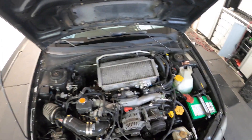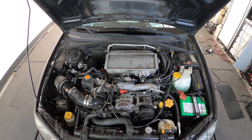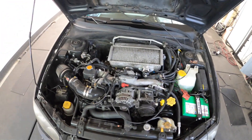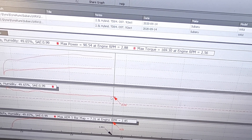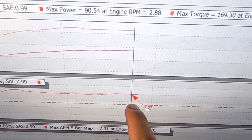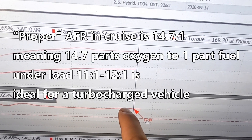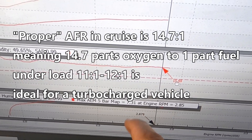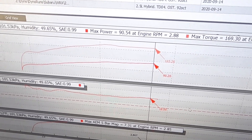So let's show you how I sorted this out. This engine had failed, customer brought it in, had us rebuild it — we built a brand new motor and put it in. I put it on the dyno and immediately ran into this issue. Here we are on the dyno screen — I only did a pull out to about 2800-2900 RPMs because our air fuel ratio right here was 15.9, you can see the AFR up in the 16s. This was on a base tune that should run pretty rich, not lean — low boost, only seven pounds. As you can see, definitely a major issue, so when I see this on the first pull I abort.